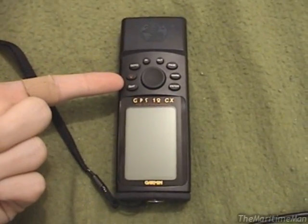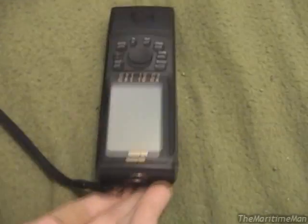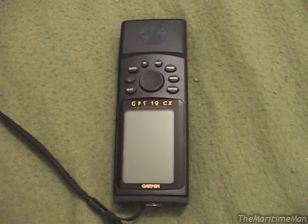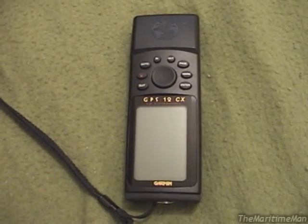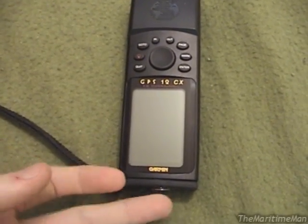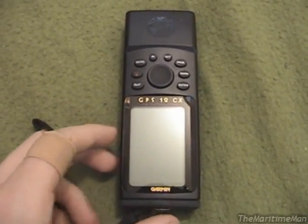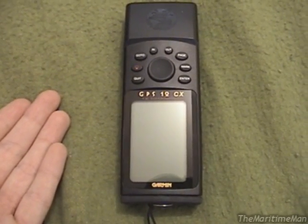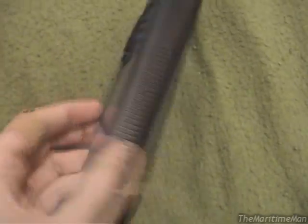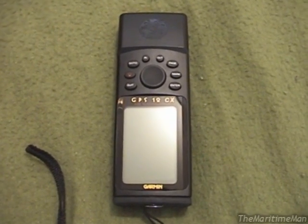This GPS started doing something a little bit weird not too long after I made the original video of it. What started happening was I'd have fresh main batteries inside it, but it would act like they were dead. It would turn on for a few seconds, say 'main batteries low,' and then shut off. When I went to the diagnostic page and looked at the voltages — it shows the voltage for both the main batteries and the power source — if I had just batteries in it but no power source plugged in, it would split the voltage of the batteries between the batteries and the power source. So let's say the batteries were fresh and made 6 volts — the diagnostic screen would say the batteries were 3 volts and there was 3 volts coming in through the power source, which is really weird. That's why the GPS thought the batteries were low — it was seeing only 3 volts.